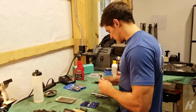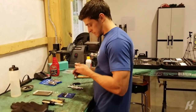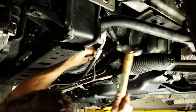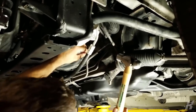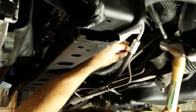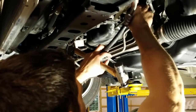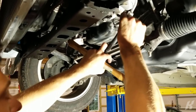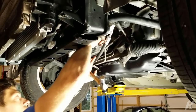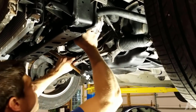I don't know if this is going to work, but it'd be cool if it did. Wouldn't see why not. Well, it's aluminum, so it's pretty soft. Keep going. There you go. You actually want that little flange that it's creating on there so you have something to tap, so you're not just tapping the thin sheet metal. That's why if you drill it, it wouldn't work as well.